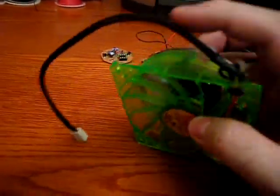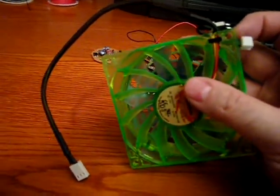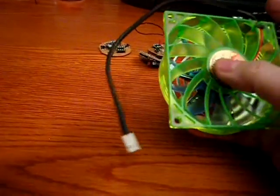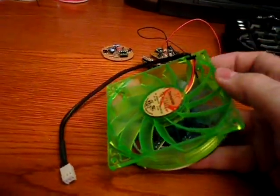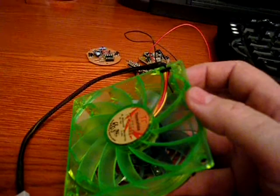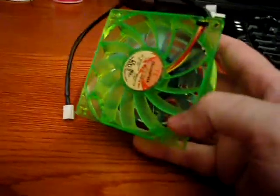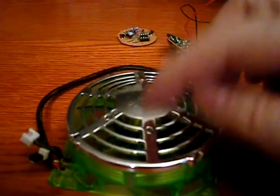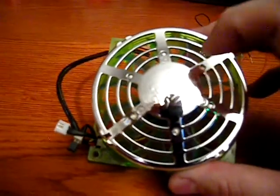If you notice, there are extra little wires all through the thing, for the thermistor that's in it and speed control. Those are garbage as soon as you take this out. The only thing worth keeping is, where I'm pointing, you can kind of see through the plastic a double wire, black and white, really thin, actually thinner than these. That goes into the front to the circuit board, which is like a six-armed piece of circuit board that goes out to each of the lights.